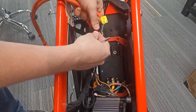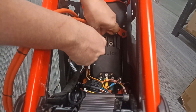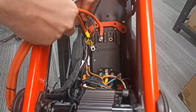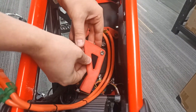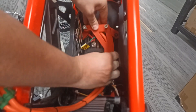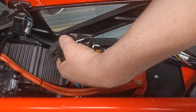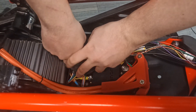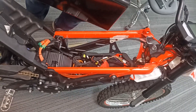Screw the power line coming from the battery to the plus and minus ends of the controller. Along with them, attach the two red and green terminals from the factory wiring. Bend the power line as shown in the video, then secure it with the plastic power line bracket. Once you've secured the power line, organize the rest of the wiring. Tie down everything that is sticking out and make sure the polarity is not reversed.